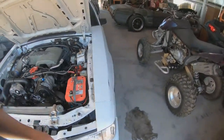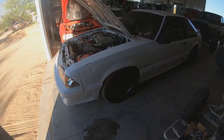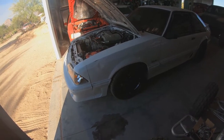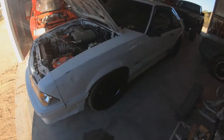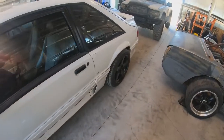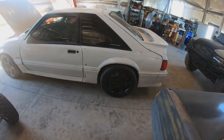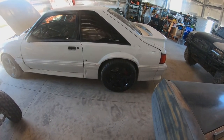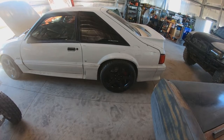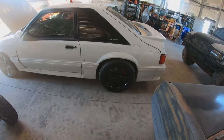So and then did a 5-lug conversion with 03 Cobra brakes and wheels. It's got cross-drilled slotted rotors, the rear and the front. And the rear end actually came out of an 05 Mustang GT, and I converted it with the Cobra brakes in the back. It does stick out a little wide on each side. I think it's like 7/8 of an inch or something. It's not quite an inch on each side, but it's a little bit much.